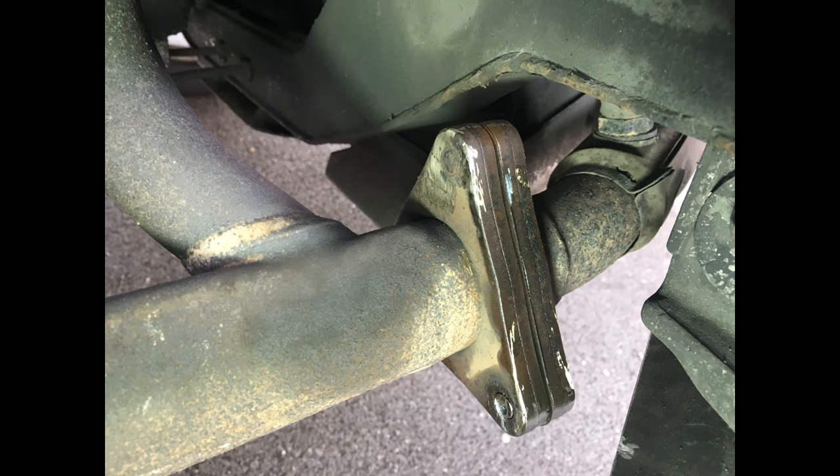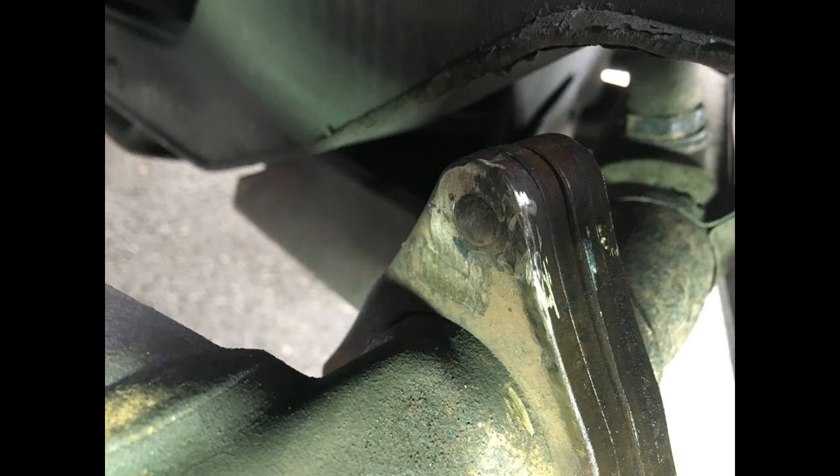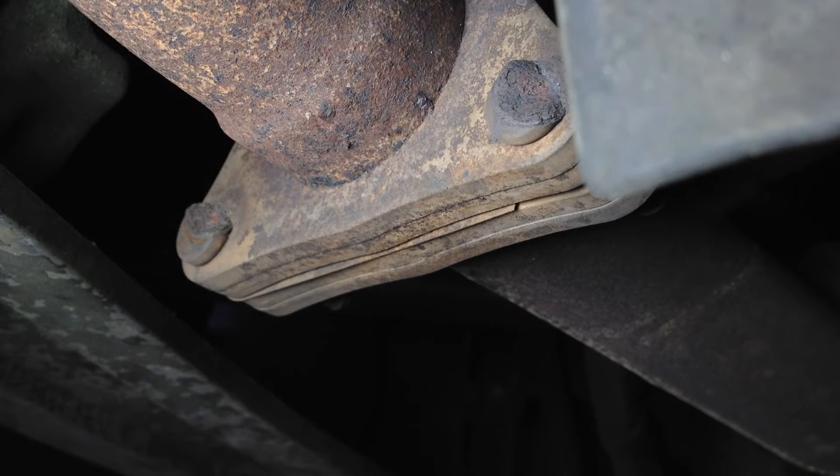So I hit the forums. Turns out they are not ordinary bolts — they are splined studs press fitted into the exhaust flange. These studs are wider at one end, so when they are press fitted they make a tight seal. I am often asked what I find the hardest part of being a home mechanic. So far I'd say it's something like this: trying to move something that's rusted away, such as a nut that has no head or a bolt that's sheared.